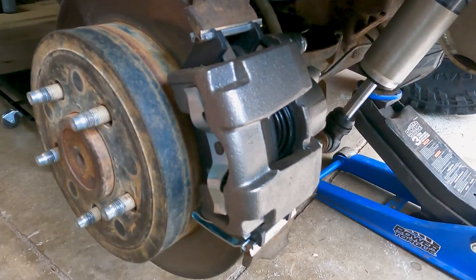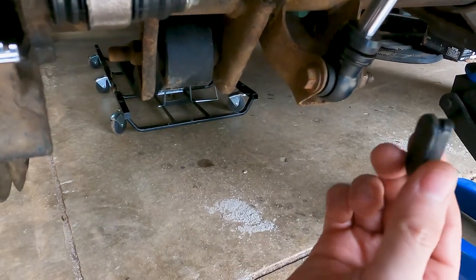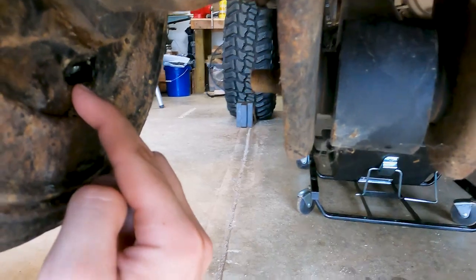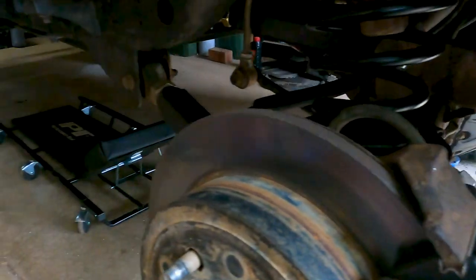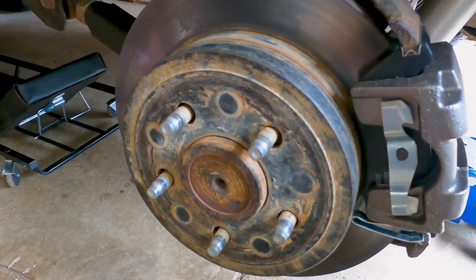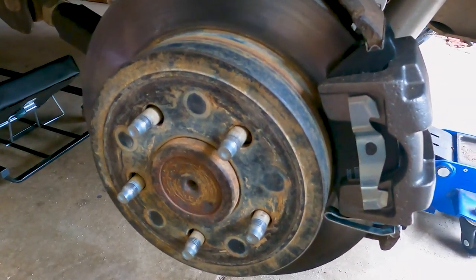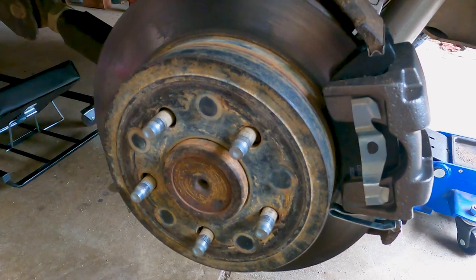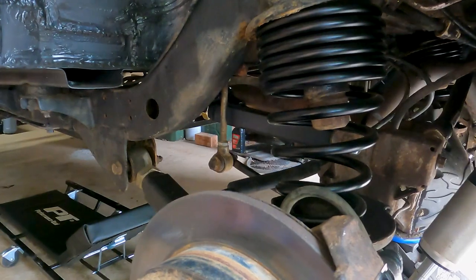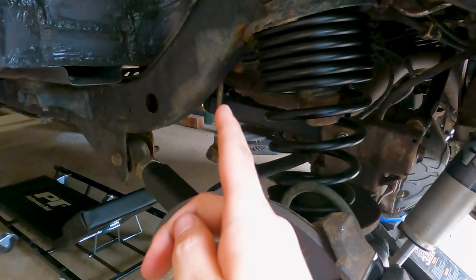This isn't a brake video, so I'm not going to go into too much detail. But you have a little opening with a rubber stopper on the rear here — that's the stopper. And then you can stick either a brake spoon or just a flathead screwdriver in there and you'll adjust that star adjuster out. It'll spread the shoes and you want to get them a little tight and make sure everything holds when you pull the brake. The other adjustment is up in the middle of the Jeep — there is an adjustment for the cable to put more tension on it. So those are your two adjustments: the star at each wheel and the bolt for the cable up there.